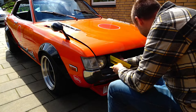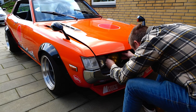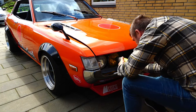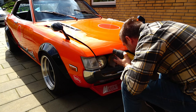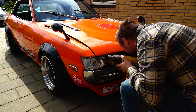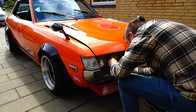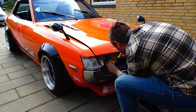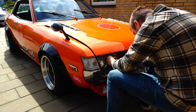I have this yellow tint — and after a good clean and dry it's time to place the stickers for the front. You pull off the backing, put the adhesive side on the light — you can get these on eBay or any parts store. Then you apply it as best you can on the front, use a heat gun to get the contours, then do the sides and corners applying heat. Always point the heat gun away from your car when you're not using it. When it's set, get a sharp razor and cut all the way around. Last step is there's a protective film — you pull that off, put on the bezel, and that's basically it for the yellow tints.